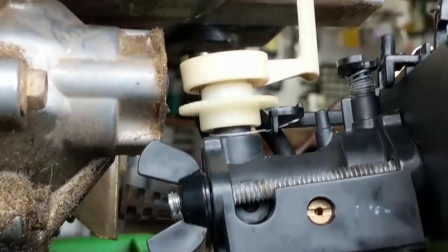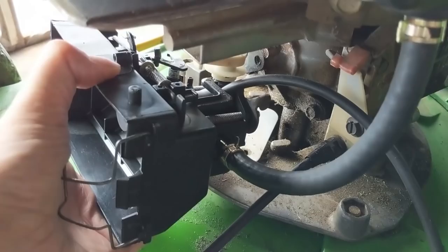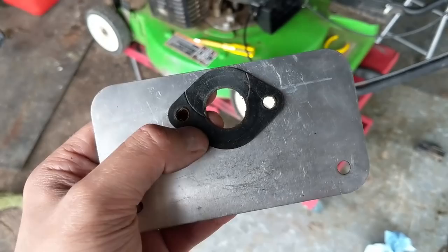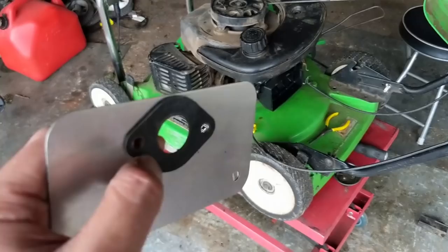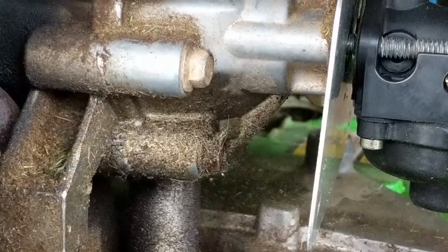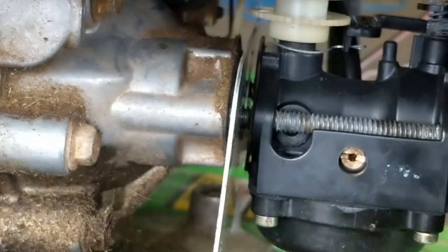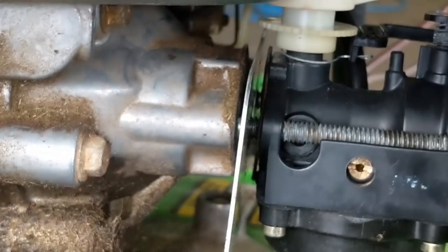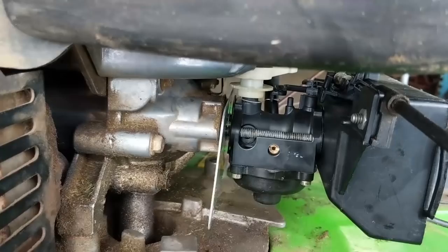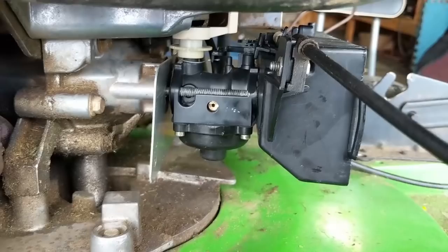The fuel line is hooked up to the carburetor with the new fuel line clamp. Once I position the carburetor against the engine, it actually pushes the fuel tank up a bit since the line is slightly longer. I wiped down the air dam and the gasket, then lined everything up and reinstalled the carburetor. The biggest piece of advice I can give: once you get those screws started, come to the side of the carburetor and look to make sure your gaskets and plate are lined up. A lot of times the gasket isn't going to stick to the engine and it may slip out — then when you fire it up it's going to be hunting and surging, and often it's just a slipped gasket.